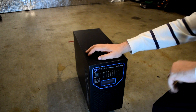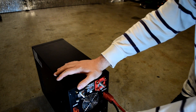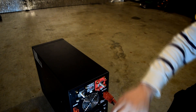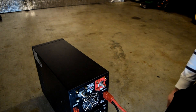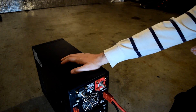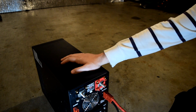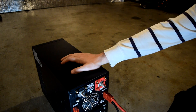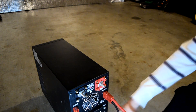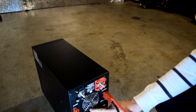For a load like a refrigerator, it will automatically turn on and off as needed. Under this cover on the back, it has a transfer switch setup. With a transfer switch it has a 10 millisecond transfer time, which is such a short amount of time it's essentially irrelevant — you would never even notice the power had switched. This makes it suitable for emergency backup use.